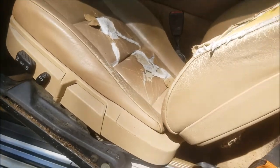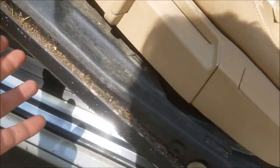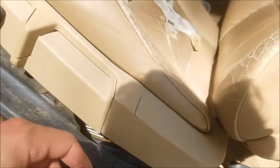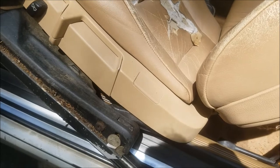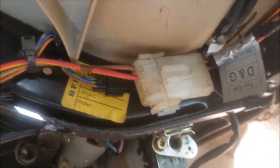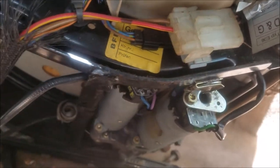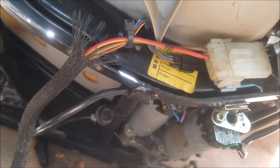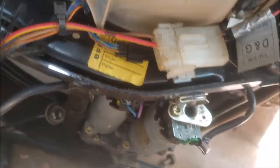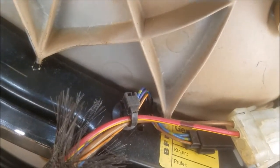Okay, so I picked up the seat. All you've got to do is pull all four bolts and the thing comes right out. You do have some wires underneath the seat that you need to disconnect — there's a wire running up to the seat with several connectors right underneath it. Disconnect those. I've just got the seat pulled up a bit so I can see underneath, and I'm going to disconnect them and then flip the entire seat. It's also got a little zip tie I'm going to have to clip, but no big deal.